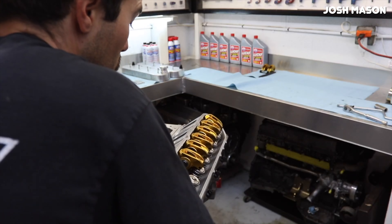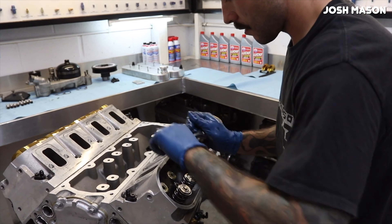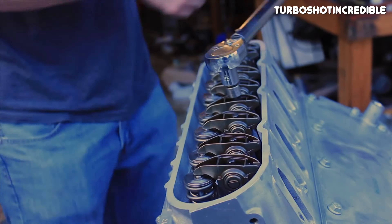Pretty much up to this point the LS6 is a slightly better engine, but when we account for pricing the story changes. Buying used, you're gonna have a much better time with an LS2. The LS6's rarity and great performance make it more expensive in comparison. The LS2 is still expensive compared to, say, the LQ truck motors, but if you had to pick one for a project car the LS2 is the better bargain. You could buy an LS2 and throw in an aftermarket camshaft and it's going to way outperform a stock LS6. Additionally, the LS2 block is compatible with the high-flowing and desirable L92 cylinder heads thanks to its larger 4-inch bore, whereas the LS6 is pretty limited on head options because of its smaller bore.